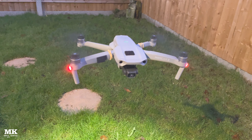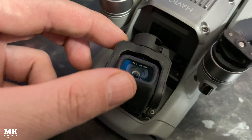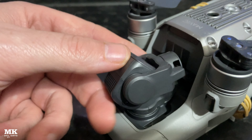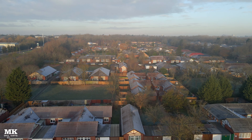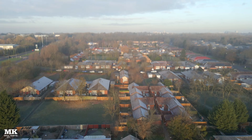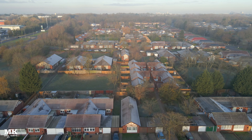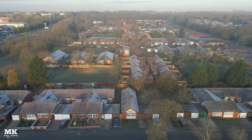However, something did go wrong. Earlier in the video, I showed you the gimbal and explained how it put itself all the way back when it crashed and I had to force it back the other way. I think it's actually damaged. So I did a little test flight to see how the gimbal is performing. Put it up in the air — let's see what happens. I go forward — ah, there you have it. Bring it back again, then go forward quickly again. And that's it — the gimbal judders; it doesn't catch up with the movement of the drone.